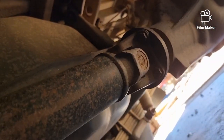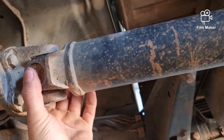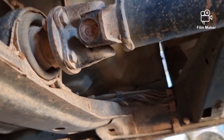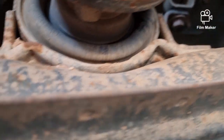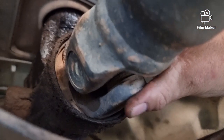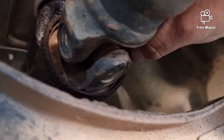We might as well have a quick look while we're under here - that uni's fine, this uni feels fine I believe. I've been waiting for this bloody centre bearing to fail - I've bought two spares. The front uni's hard to check with one hand but I think that one's all right too. You hardly ever do a front one because they are straight.